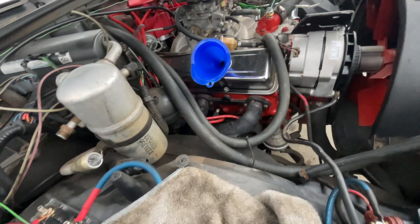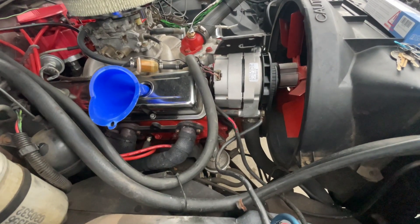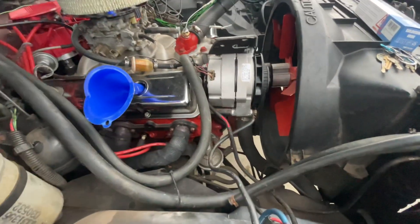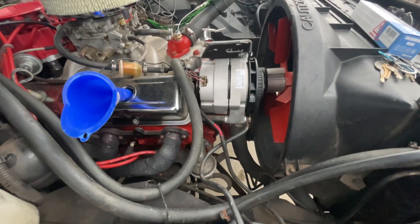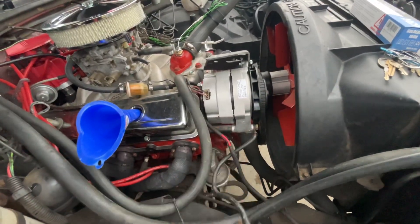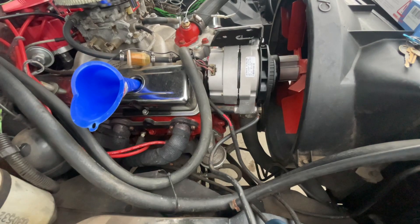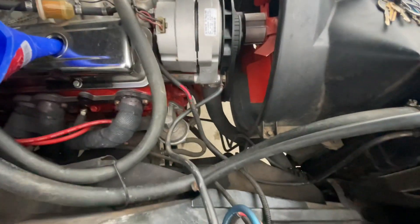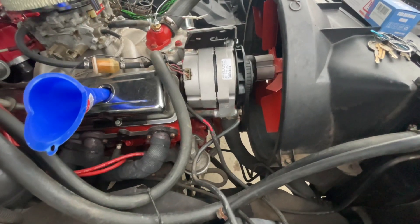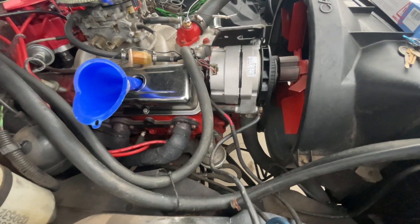I made a post on Facebook and people were telling me to do the big three — that should solve the issue. Test the alternator, test the battery. Tomorrow I'm gonna get both tested. If they both come back good, then I'll know my issue is that I need more charging amps for everything I'm running. If y'all think that's the issue and I need bigger cables, bigger ground, bigger alternator — let me know so I can start getting the ball rolling on parts.